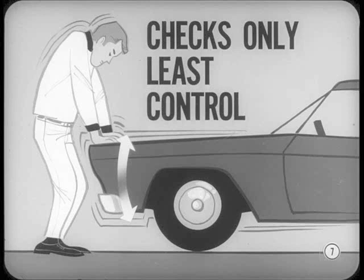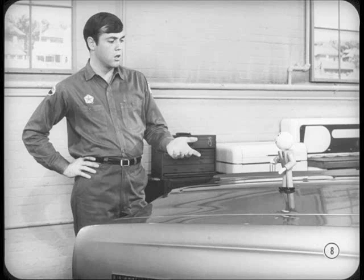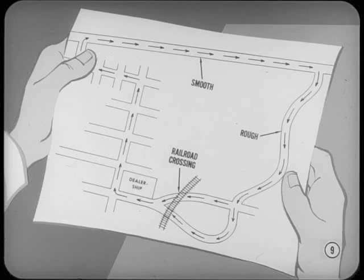Besides, bouncing may not help much to tell you which side is acting up. Why worry about sides? Aren't you supposed to replace shock absorbers in pairs? Only where high mileage or bad leaks make their general condition doubtful. On fairly new cars, there's no need to put on a pair if only one shock absorber goes sour. I'm sold on the need for road testing, but how can you tell what's good or bad?